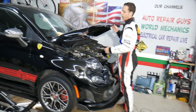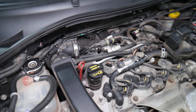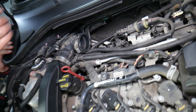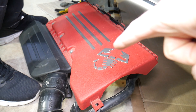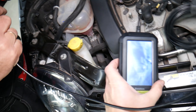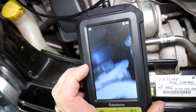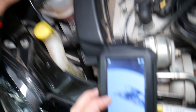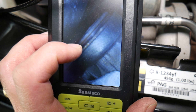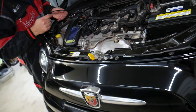We have the Abarth here, but it doesn't matter — twin air, diesel, or gasoline, this will work on all of them. On the Abarth it's a little more limited in room because of everything the engine has, but the AC compressor is towards the back side — it's very inconvenient. We have the air filter box assembly removed; you can see it right there, as it blocks everything. We'll use the endoscope camera — if you want to buy one, I'll put the link in the description below. Right there — that's your AC clutch, all the way in the back.